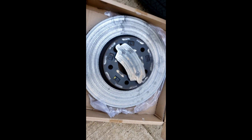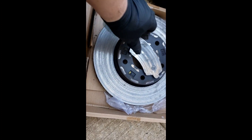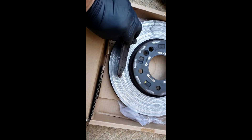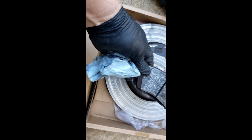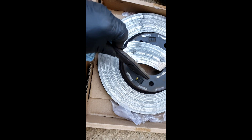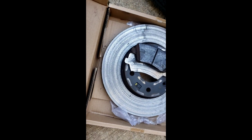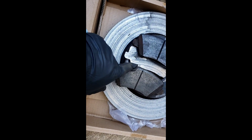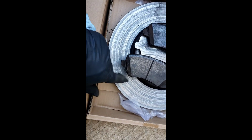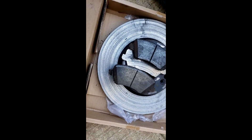There you go — there's your brakes, pads, and your rotor. All gone. There's no more material left on it. The backside has a little bit, but very thin — hardly anything. Let's see what the other side looks like. This one's a little better. You can see where the grooves are. That's the rust that was on the edges of the rotor — it starts to cut into the brake pads. And this is the other one.